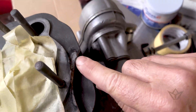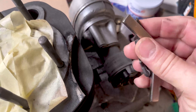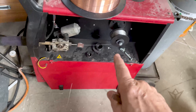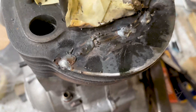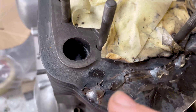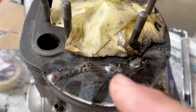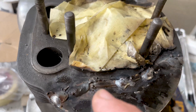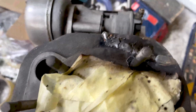The good news is that it is actually gripping — it's actually going into the cast. Unfortunately I have to start again. There's the stainless steel in there. I'll make a few more adjustments on the MIG to see if I can get it to work. That was better — you can see the weld has really gone into both sides now. It was a voltage issue on this Lincoln MIG. With a few tweaks, I changed the voltage because this plate is slightly thinner. I'm going to grind this all clean and it should look a lot better.